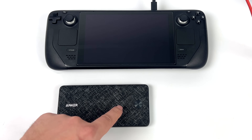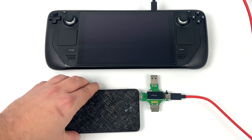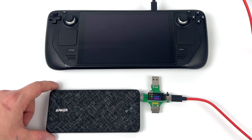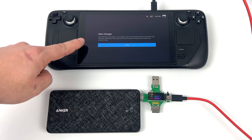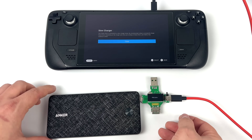Moving over to the Anker Metro 20,000 milliamp hour battery — they claim it'll do up to 20 watts, but unfortunately this is one of the worst battery packs I've ever tested with the Steam Deck. It comes down to it not detecting PD charging technology, so it's only charging at 5 volts and we can't get anywhere close to 20 watts out of this unit. Plugging it in without the multimeter still doesn't do much. With the latest Steam Deck firmware you'll get a slow charge notification. You could still charge the unit with this but it'll take a while and you really won't be able to play while charging — it'll still deplete the battery. So the Anker Metro is out of the question, at least in my opinion.